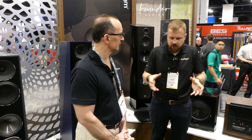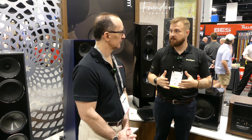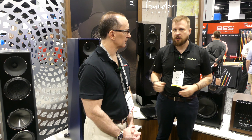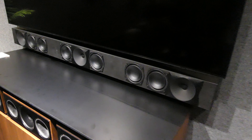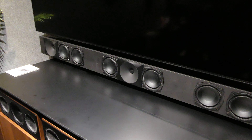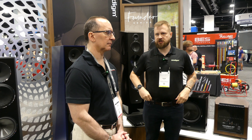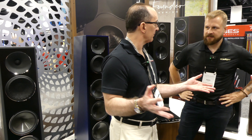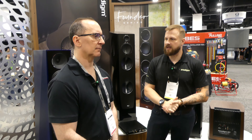Before, we had standard driver arrays for each model, and as they got bigger they would just grow larger. They sounded great, but we had more room for drivers that we didn't use. Now, as the soundbar grows, we've got different segments of drivers to add — whether active drivers or in some cases passive radiators — to get the best sound. You get better bass extension and more SPL. It's a better overall experience as you make use of that larger cabinet. Some competitors do custom-size soundbars, but they just leave empty space without adding extra drivers to get the performance advantage.